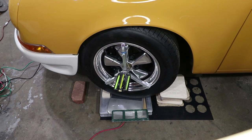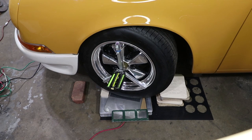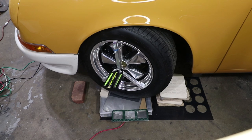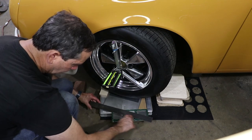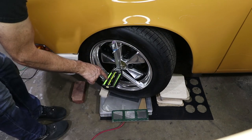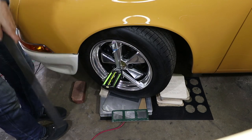The steering wheel is effortless. Super easy to get this to turn. Really like these slip plates. It's working perfectly. So I think I got a little more to go. I think that is 20 degrees right there. All right, there on the same line. And then I'm showing a caster of, I'm getting a little less than 3. I'm gonna call it 2.9.